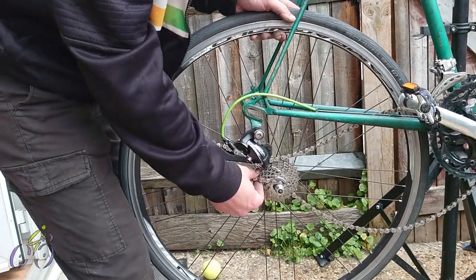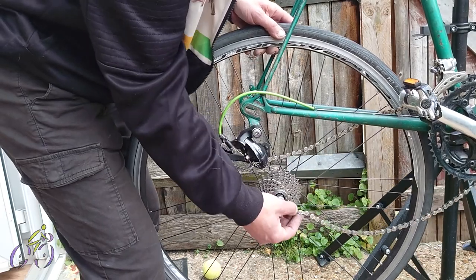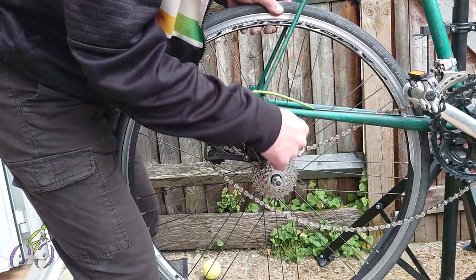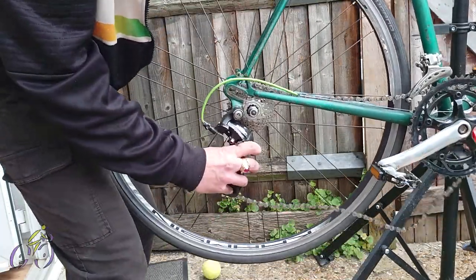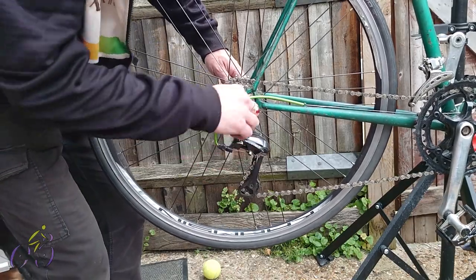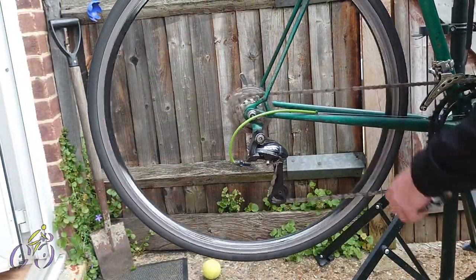Then it's time to put it back on the bike. When replacing the wheel — if your bike is geared, lift the wheel up almost into position. Make sure the chain hanging at the bottom is over the top of your wheel nut, and the top part should be sitting on top of the gears. Once it's like this, if you push down on the derailleur, it should slide up into position. Once you've got it there, pop the wheel into place and tighten it up. And job done — one puncture fixed.